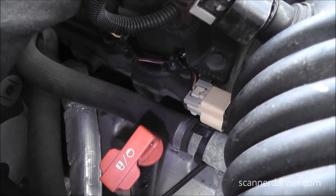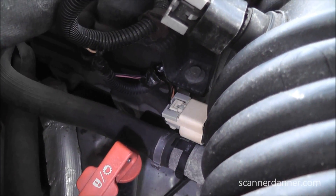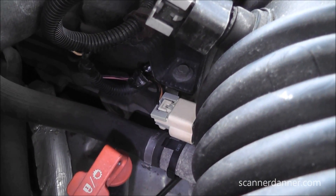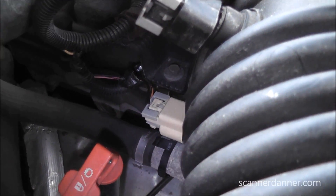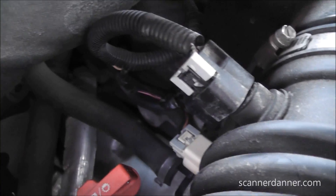You can really hear that air pump struggling when the line is plugged back in. That suggests right from the get-go that this solenoid slash diverter is not opening. So what we need to do now is some solenoid checks, and we have to determine the system design before we can check it properly. Let me turn the air pump back off.